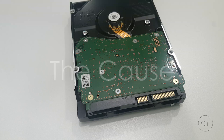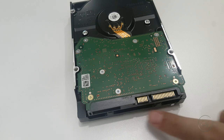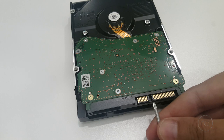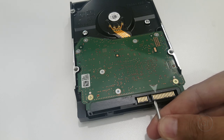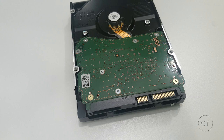The cause is a new SATA specification which includes the ability to disable power to the hard disk. When you look at the SATA connections on the back of your hard drive, you have the narrow data connector and the wider power connector. On the power side, there are 15 pins that make contact with your power supply. It's the third pin that delivers a 3.3-volt signal that disables the drive. What we need to do is prevent that third pin from making contact with the power cable.